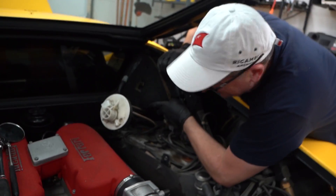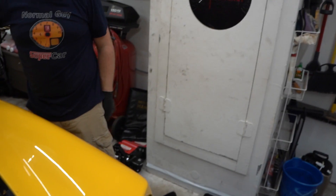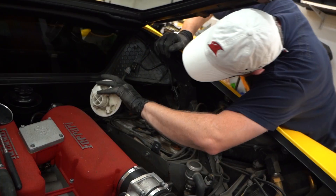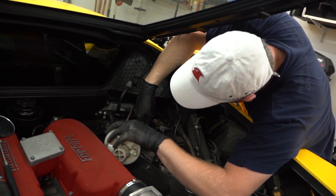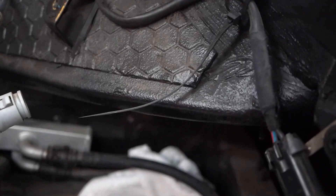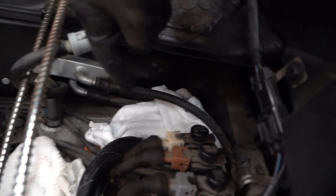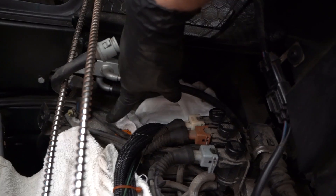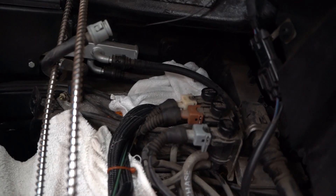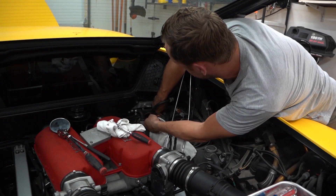Come on out - how the hell is that gonna come out? We're pulling off the insulation to get a little more room. It's got these little clips you just pop off with a screwdriver. The problem is this frame piece right here doesn't give enough clearance to actually get the pumps in or out. What we're going to do is take off all these screws around the top of the fuel tank piece so we can slide it over, then it should clear. Let's see if our theory is correct - I think if I put it at an angle...